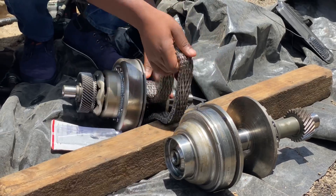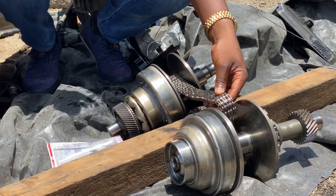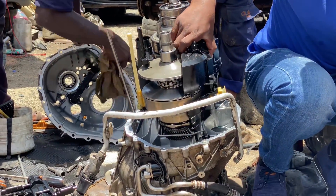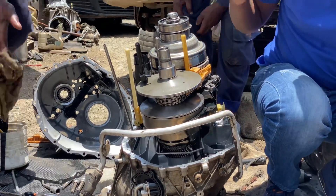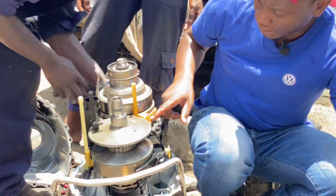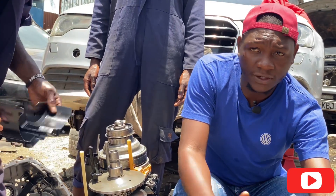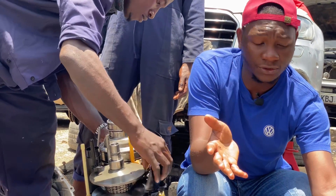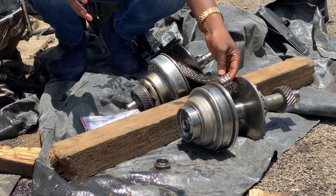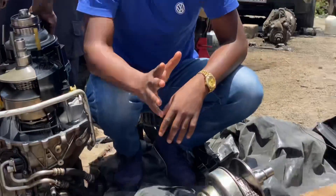This belt comes in between here. When you put your car in drive or reverse, based on the throttle input, we have a fork over here that you can see. This fork is shifted using the transmission fluid — pressure differences are what moves this fork. This fork moves the chain based on throttle input, traction, road conditions, whether you're going uphill or downhill, and how much throttle input you have. So this belt keeps varying from one side to the other to increase the surface area based on how much power is needed. That is how it's called continuous variable transmission.